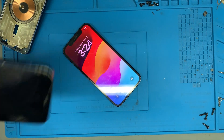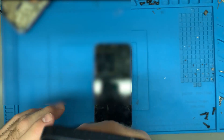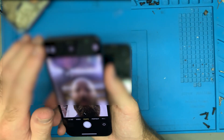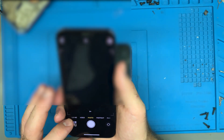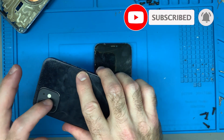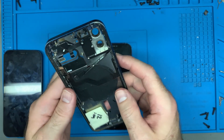I'm going to get the screen off. I've got another iPhone 12 that I bought as a parts phone — I can get the camera out of there and use it for testing. The face cam works, which is very reassuring. The camera flash doesn't seem to be working, but it's taking pictures. If you switch back to the rear camera though, it's getting nothing at all. Maybe it is the camera module — I'm really hoping it is. Maybe that's also why the flash isn't working; it could have something to do with the camera module, and I might not have to replace the flash at all. I'm really hoping not to — it is a royal pain.